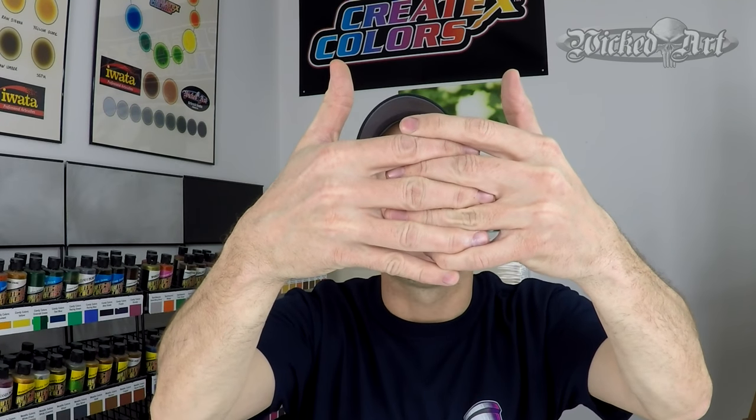Now we have a clean surface to begin this project on. When it comes to adhesion, in the custom paint world we basically have two ways to get good paint adhesion. The first is mechanical adhesion and the second is chemical adhesion. Mechanical adhesion occurs when you're sanding the surface — whether using sandpaper or a Scotch-Brite pad, you're putting very minor scratches into the surface and that gives the paint something to bite into. The paint flows into those scratches creating a mechanical bond. Chemical adhesion is when the paint adheres to itself through a chemical process — once you put down your primer, sealer coat, or base coat, you can apply additional coats and the paint will adhere to itself without needing to sand or scuff between layers.